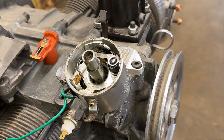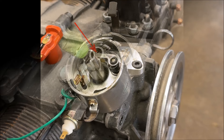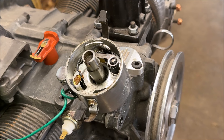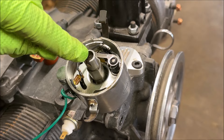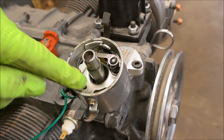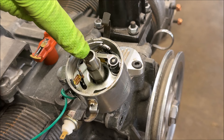Look down inside the shaft — do you see a little felt pad? There's a felt pad that sits down inside of there. Check on it once in a while when you're doing an oil change or something. Remove your distributor cap, remove your rotor, and you'll see the little felt pad. Take about three drops of oil and just drip it on there. Don't get sloppy and drip oil all over your points. Just about three or four little drops of oil on that felt pad.